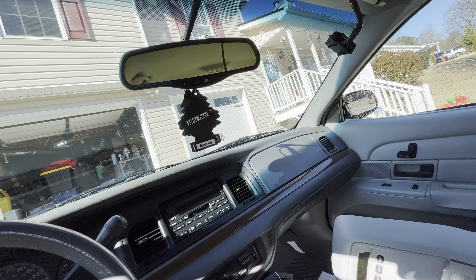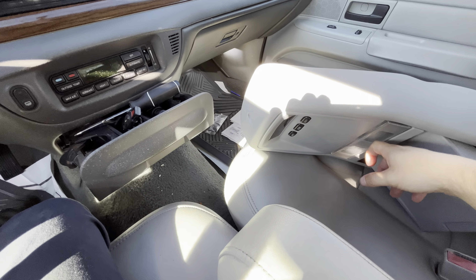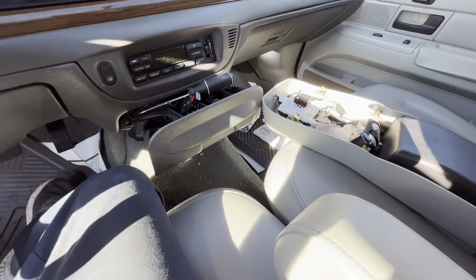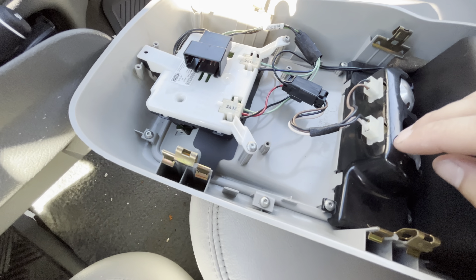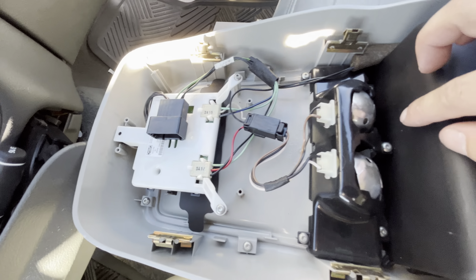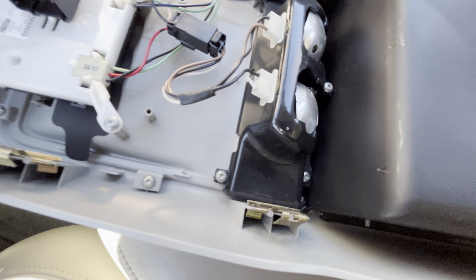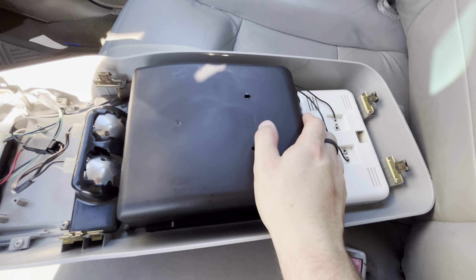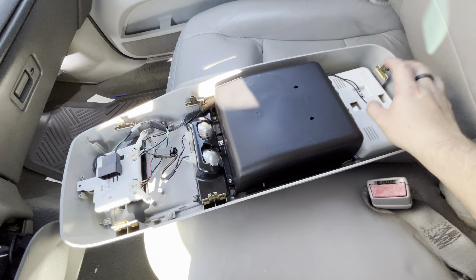Anyway, the main reason I pulled mine down was to do the lights in the front and the rear. I don't know the bulb sizes off the top of my head — I'll put those in the description. To replace the front ones, all I did was remove this screw right here, that screw there, and that screw there. They're Torx — I'll put the size in the description. Same thing with this one: removed this screw and those two screws, then you can just pull up on the tray and it slides up and out, with the wires staying connected.